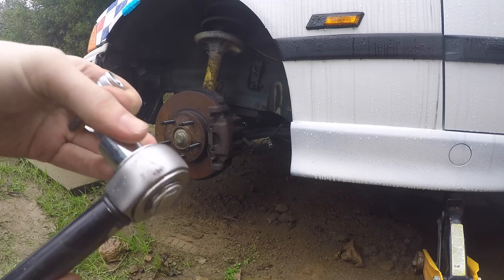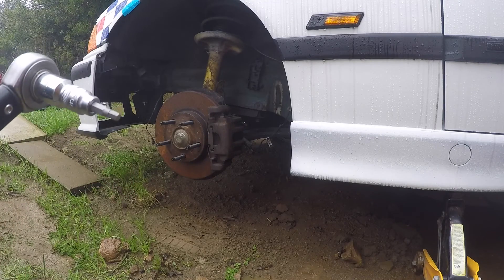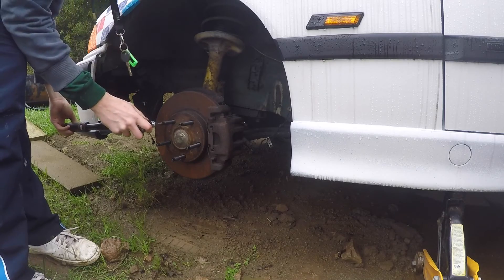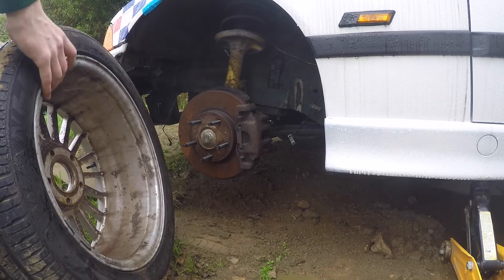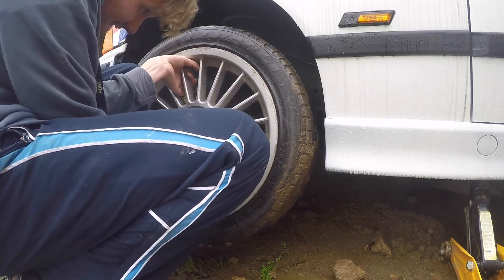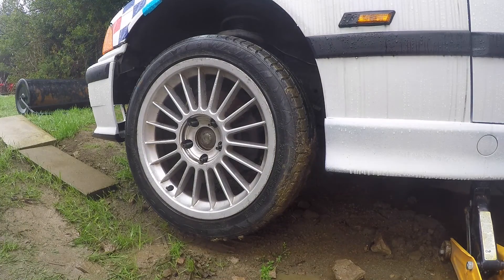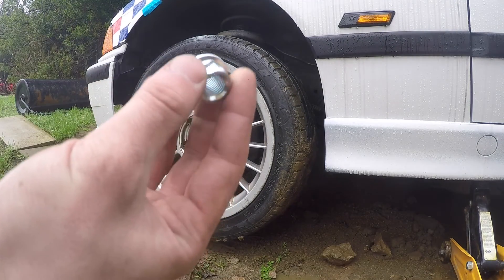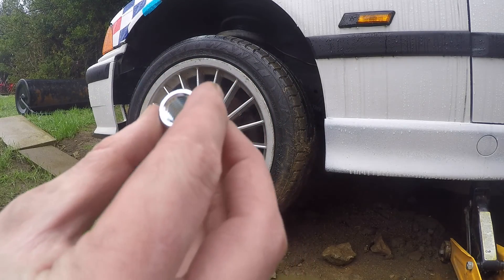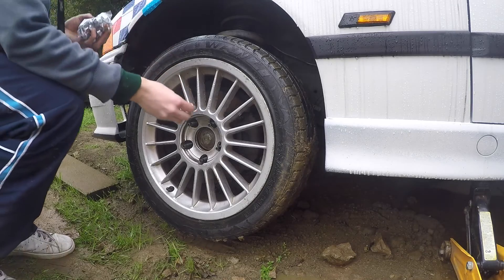After they're on tightly, you actually need to torque them down properly to spec. I think 15 to 25 foot-pounds is recommended, and I'm using an adapter here so you've got to compensate for a bit, but just make sure you use a proper torque wrench. Once they're properly torqued, you can now put the wheel on — this is the main benefit of the system. It took me a bit of getting used to, but it's so much easier than doing the bolts. The wheel just lies on it, and then you can leave the wheel on and get the nut separately, rather than having to do it all at the same time. The open-end nuts are 17mm, and you need to torque these down to 88 foot-pounds.